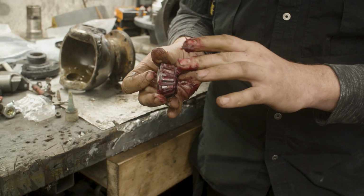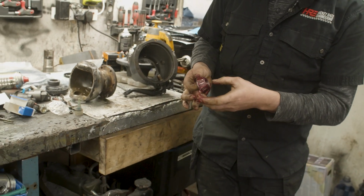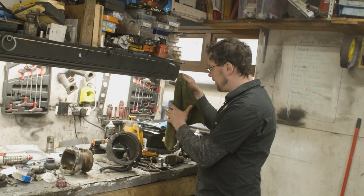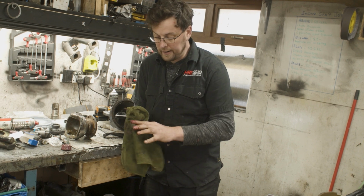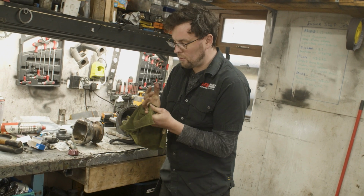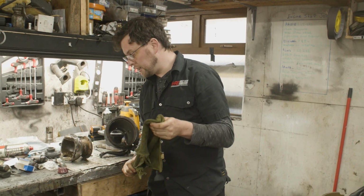It's a messy job. There's no nice way of greasing up a bearing. It's always going to be a messy job. But the difference between greasing a taper roller bearing right and wrong is the difference of a taper roller bearing lasting the lifetime that it should. Okay, so a good quality taper roller bearing, well greased, is a fit and forget item. It doesn't give problems.